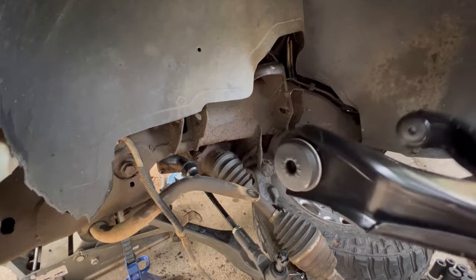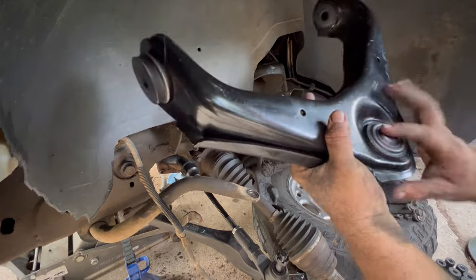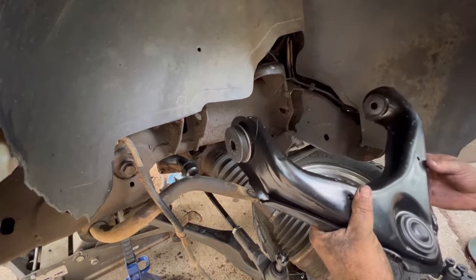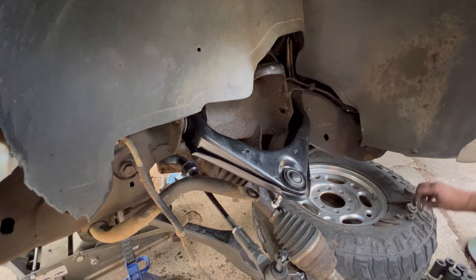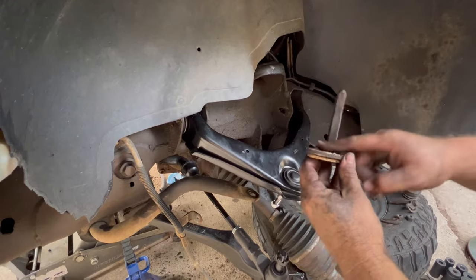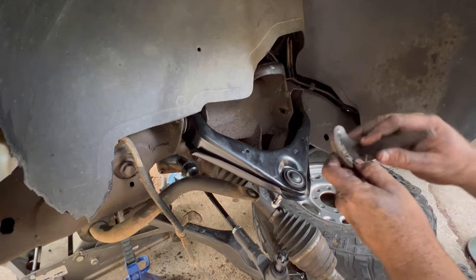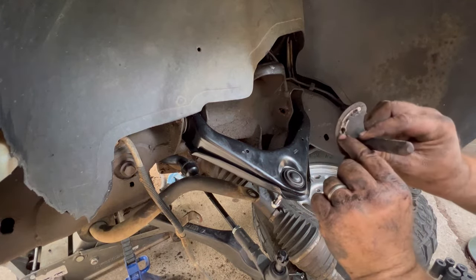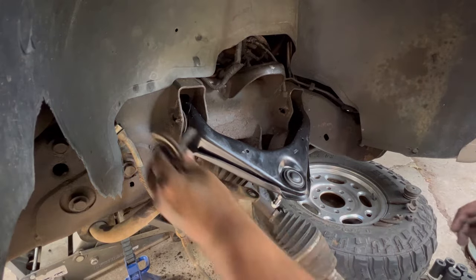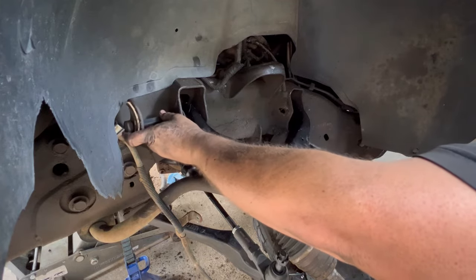Now that we've got those hubs together, let's talk about putting the upper control arm on. If I had one complaint about the upper control arm, there is no greasable Zerk on this one — but they're not that hard to replace, so we'll roll with it. You have these guide bolts here that are flat on one side, and these cams have slots. You can see there's a pinhole right there where this was, so when I put this bolt in, I'm going to attempt to get it to line up pretty close to where it was.